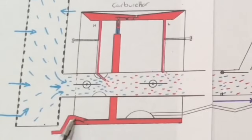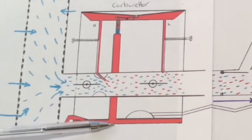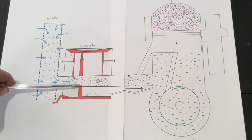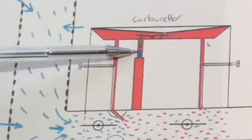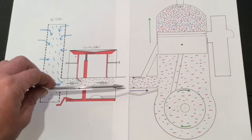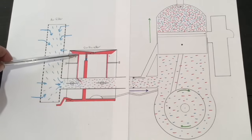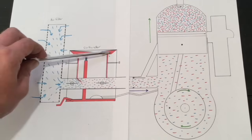Now the fuel can't go back to the tank because fuel originally was sucked through a valve flap. So when the pressure goes back there, it closes that valve flap, leaving only one place for the fuel to go — and that's up this way, through here, and up to the bottom of the needle valve. Because we're working at optimal operation here, so quite high revs, there's fuel being used, and because there's fuel being used, the fuel has to keep being fed down here. So fuel is leaving this area.